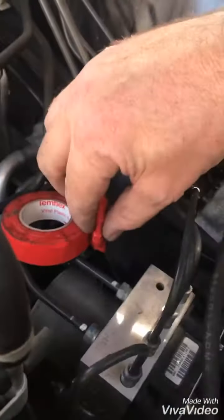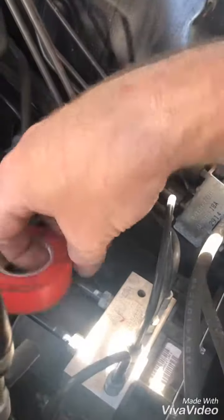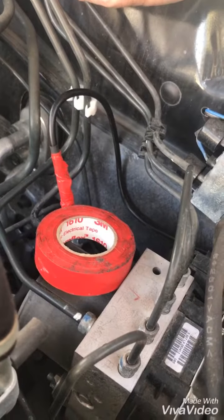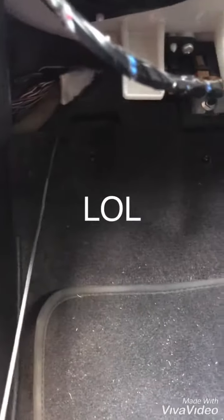So I've taped it up. It's got a nice smooth end on it. I'm just going to rip this tape off in a second and pull it through, then I can finish the install. Slow and continual pull — no jerking motions or anything. You'll feel a bit of resistance when it gets to the actual grommet. If you just pull slowly it should come through. Just make sure you leave yourself some slack in the engine bay too, so you don't get snagged on anything.